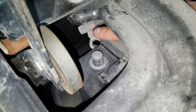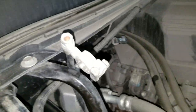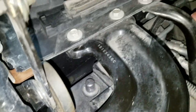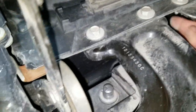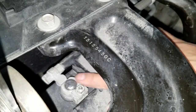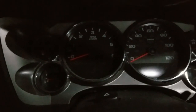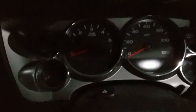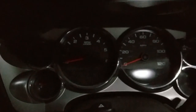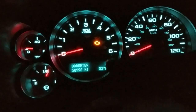If you'd like, it's a good time to clean your battery terminals. Went ahead and cleaned the battery terminal and scrubbed down the cable. What we want to do now is plug it back into the battery and tighten the bolt. Tighten that 10mm nut until it's snug. Once the battery is plugged back in, the connection is tightened, and the hood shut, go ahead and enter the truck, put the ignition key in, shut the door, and turn the ignition switch to the on position. If we did it right, the warning in the cluster here should go away.